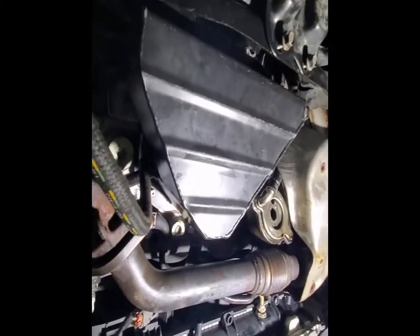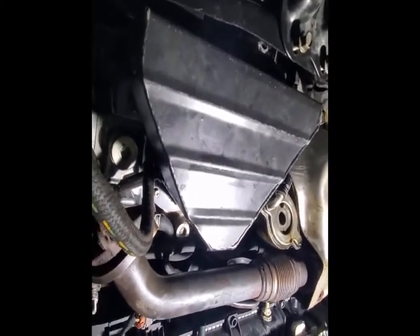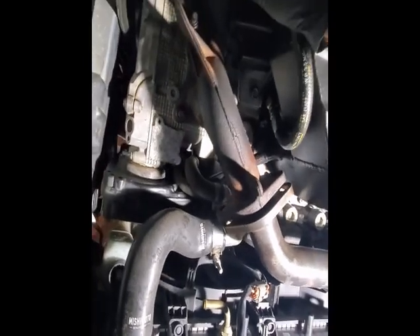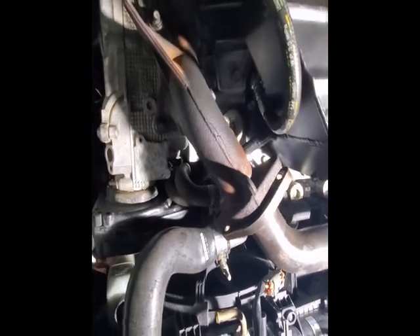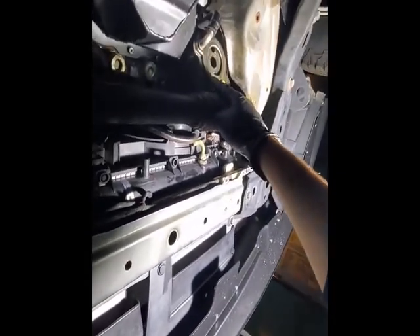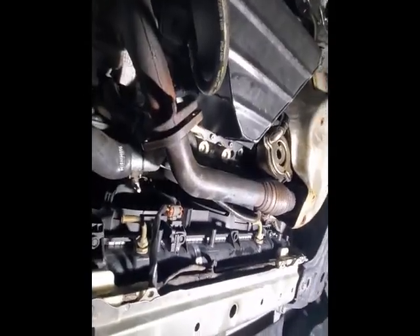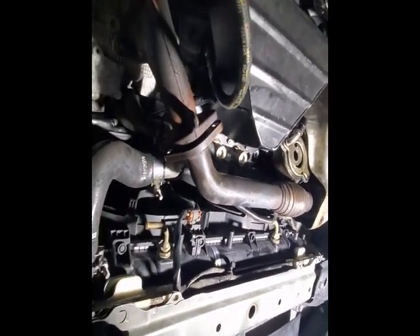I've got the pan back on and the new oil pickup's in there. It's all torqued down with the new gasket. This is my return line here from the filter, which is going to be over there. So it'll go in from the top ones we were talking about, go into the filter, come out, and go right into this return line here which goes into the side of the oil pan. So now I'm just mounting on the manifold here and we're going to put together all these shroud pieces and put this oil cooler thing back on, torque down those bolts, and hopefully be able to lower the motor. I'd like to finish this up tonight.